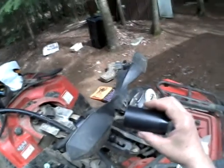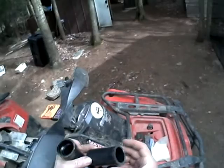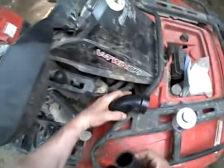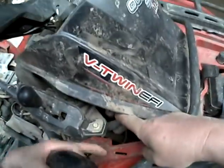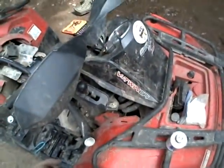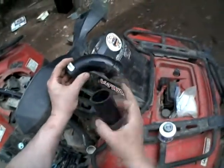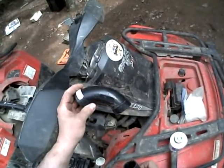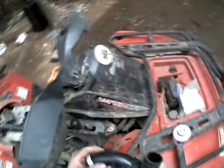I've cut off about a three and a half to four inch piece of inch and a half pipe. What we're going to do is go down in through here — you can see there's a space where the exhaust can point down. We're going to glue this extra-long elbow here onto the fitting and hook it onto the inch and a half.